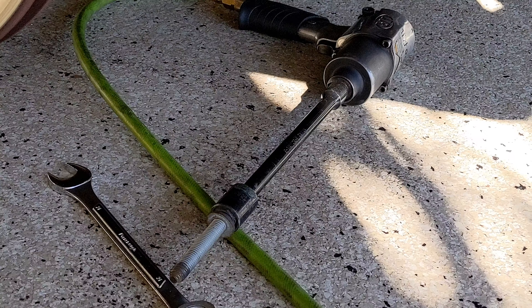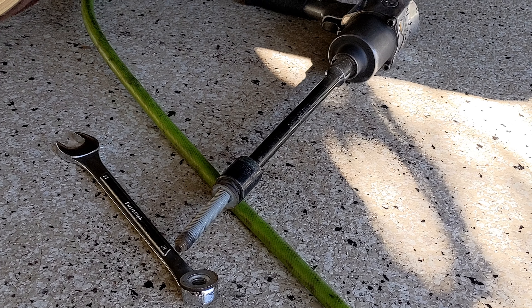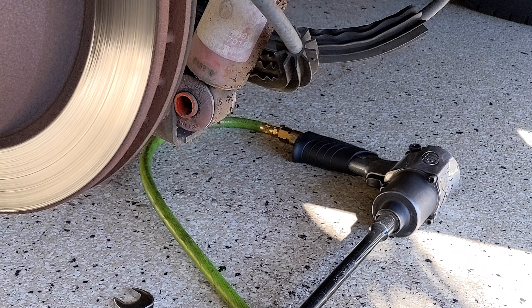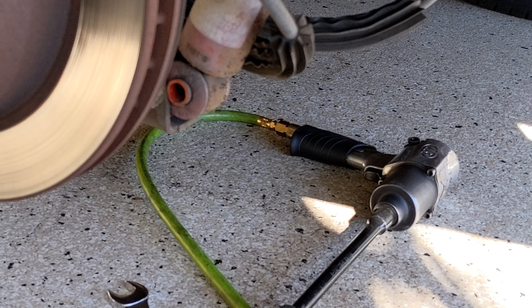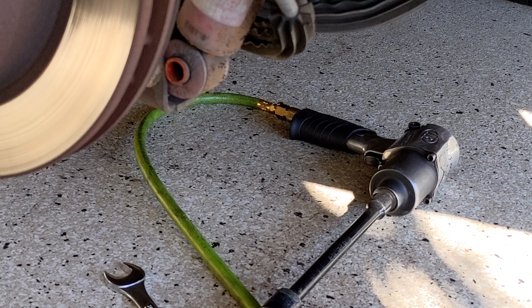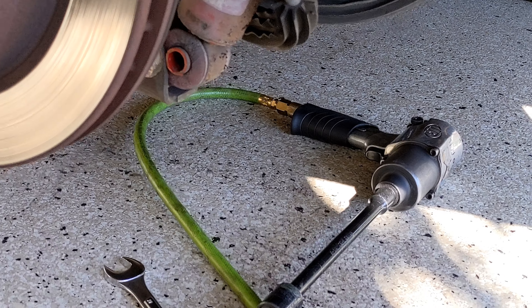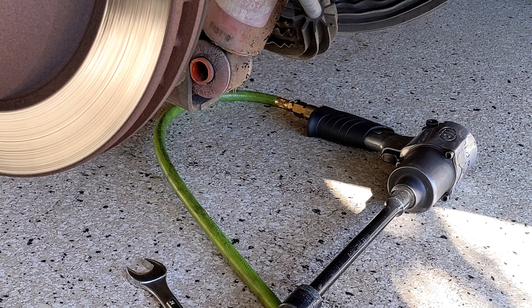So that's difference number one. Here's your tip: I used a long extension to get clear of those parking brake lines, because if I tried to get the gun in close to the bolt head, they would have been in the way. But with the extension, no problem. Also, I noticed that the rear axle dropped down maybe a quarter of an inch when the bolt popped out.